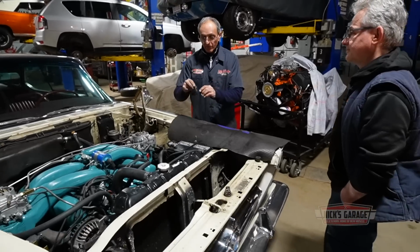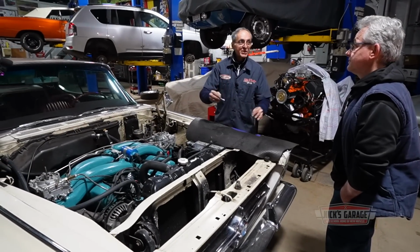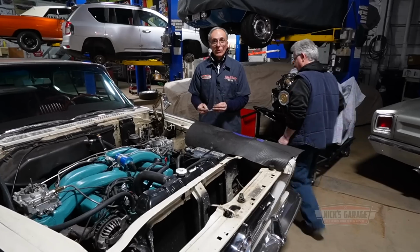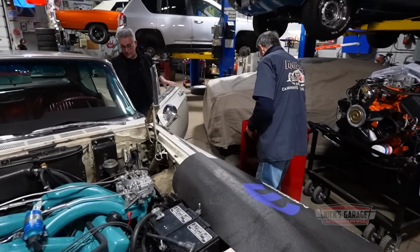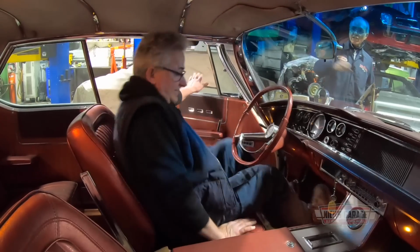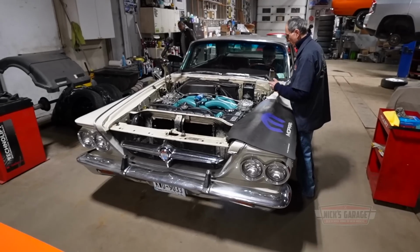So I believe this spring was overpowering the spring on the accelerator pump. So Manny, start it, and if it works, all this issue was just the spring. So start her up. I'm gonna look at the light, let her run for a few seconds, fill up the float bowl, and we'll take it from there. You ready? God, better work. Come on, go ahead.